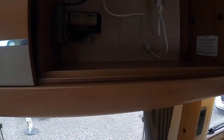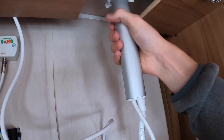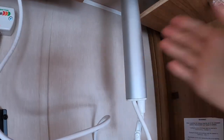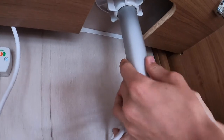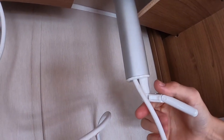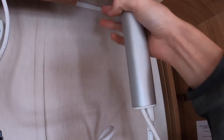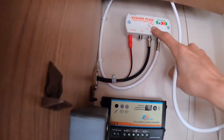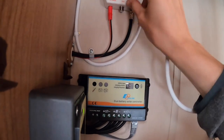You've got your aerial — this is your TV aerial. When travelling, make sure you loosen the nut off and pull it in as close into the vehicle as you can. Once on site, you can push it up and turn the toggle here to rotate the aerial and find the best signal. A tip is to just look where the other motorhomes and caravans are pointing. On the Vision Plus booster here, you do have a little booster so you can boost from minimum to maximum should you be struggling to get a signal.